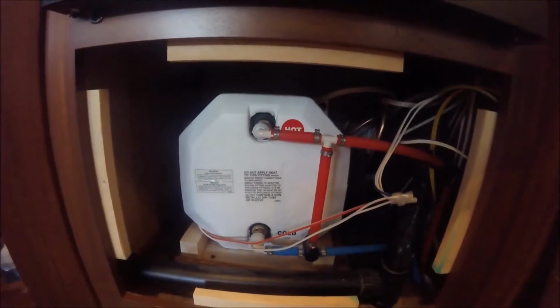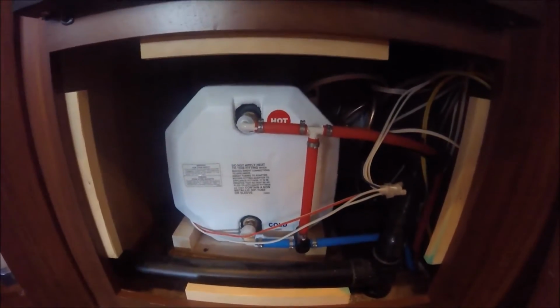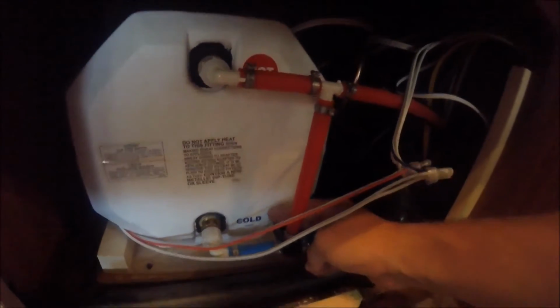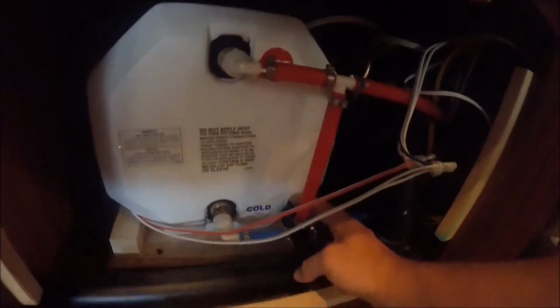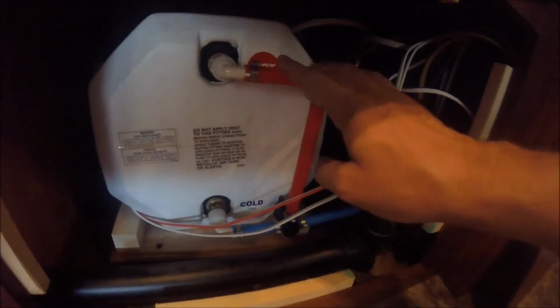Okay, now inside the camper, underneath my stove and oven here is our hot water tank. Whenever you winterize, there's a little switch back here that you switch, and it bypasses the hot water tank. So I don't want to put any chlorine in there. I think that would probably be bad. So I've switched the bypass on, so the chlorinated water shouldn't go into the hot water tank.